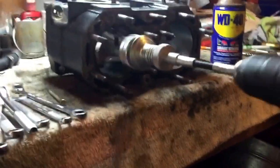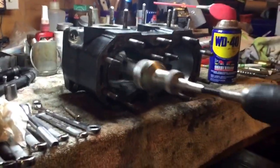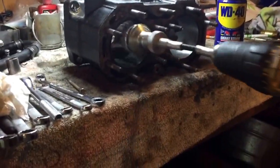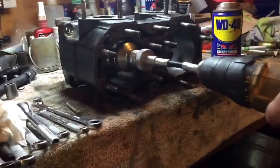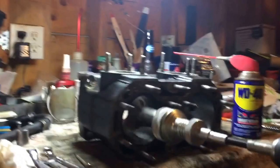So that the new rings can seat. You are taking a little bit of material off, but it's not a lot to make a difference. People do say you can't do this too much, but it all depends on your cylinder. So a few minutes of this, and then I'm going to get a ring and show you what it should look like.